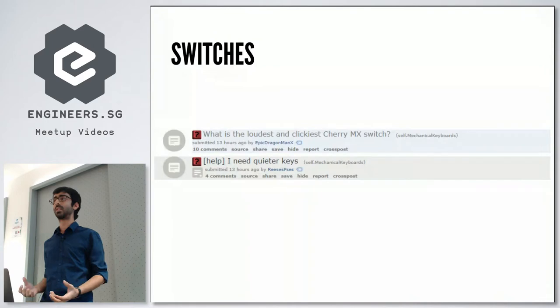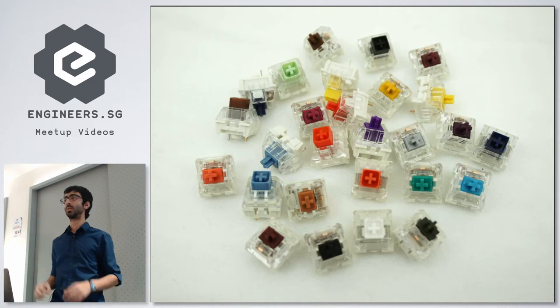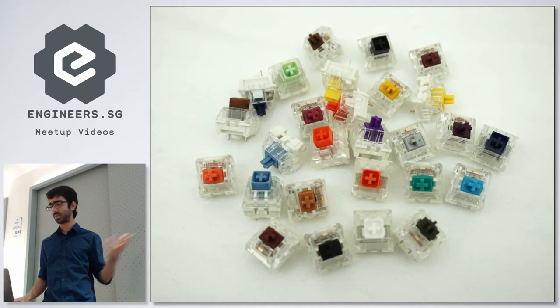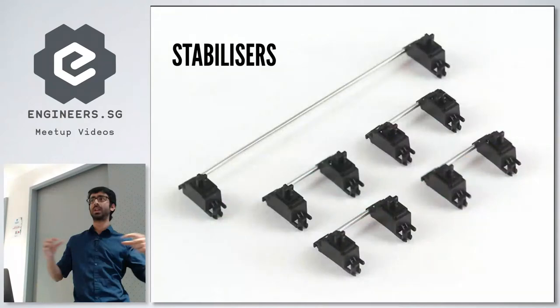Switches are the other big decision — there are a ton of varieties, options, and feels, and it's very subjective. There's no wrong answer; it's just what feels good to you. The two main types are linear switches and tactile switches. The difference is that with tactile switches you feel a little bump when you press them down. Within tactile switches there are clicky ones, which are noisy and make a clicking sound, and quiet ones, which have the bump but don't make that sound. Across both categories there's the weight of the switch — how much pressure you need to activate it. Most switches have the plus-style Cherry-style stem, but some don't, so keep that in mind when buying keycaps. There are also low-profile switches, almost like laptop switches. Stabilizers are for your big keys — spacebar, big shift, enter, backspace — to basically stabilize them.